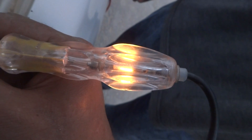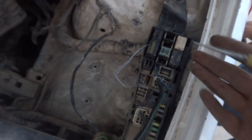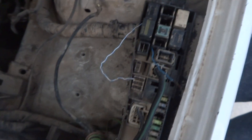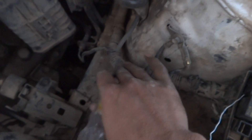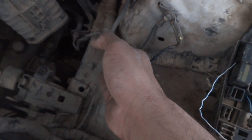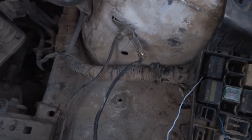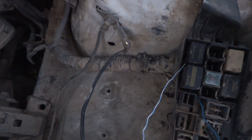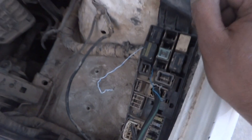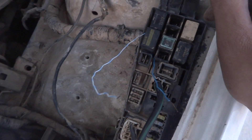The tester is glowing a little more because both relay coils are getting power. This was the repair on this particular car and it is a successful repair. I did not repair the harness — if I had, it would have taken a full day to open the harness and find the fault. Instead I jumped it and it works just as it should. Thank you for watching — keep watching, stay tuned, and please subscribe and like.